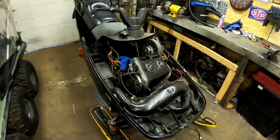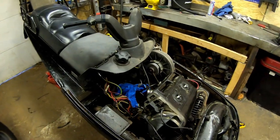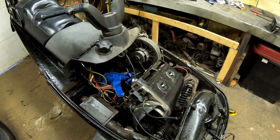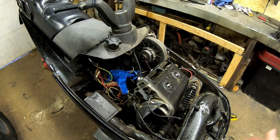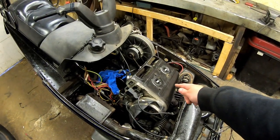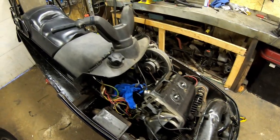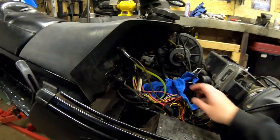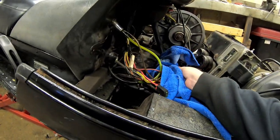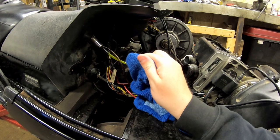She's pushing out about 125 to 130 PSI on one cylinder and about 150 on the other. That's a lot of compression. Ideally you want 150 on both sides — maybe a little bit of oil down in the low one and she might come up to 150. I don't have a wire diagram printed out, but I'll get the throttle slides and move this out of the way.